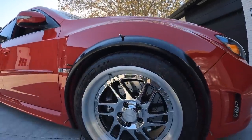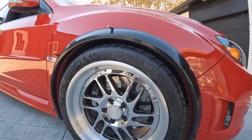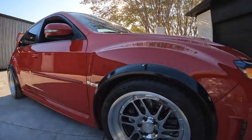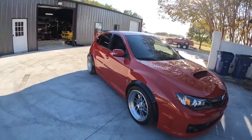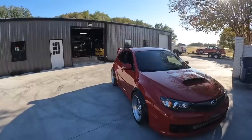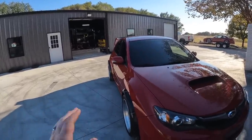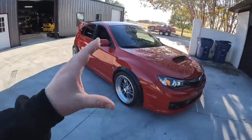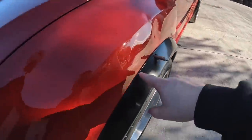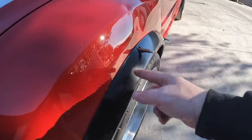These are my signature wheels from Heritage — 16-inch faces and 18-inch step lips, so it goes up to 18 inches. That's not going to be the final wheel, but this will be close to the fitment. It'll be a little lower with a little more negative camber, and a stickier tire with a really cool tread on it. This isn't even molded yet — I haven't put anything on it. Honestly, if I just had these painted and polished I could rivet them on and drive around today. Super easy, but we're not going to do that.